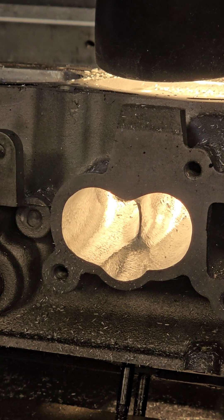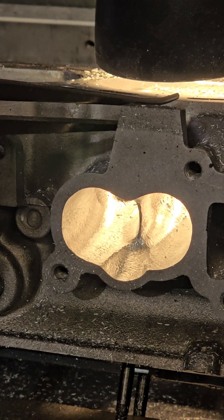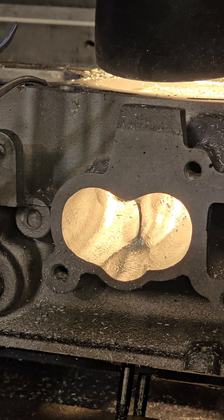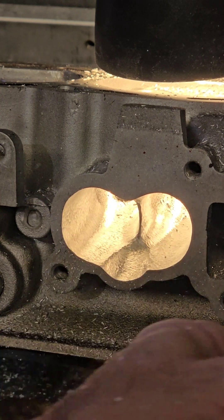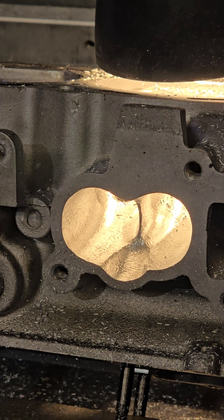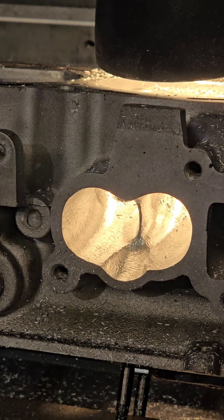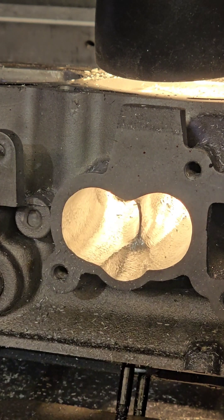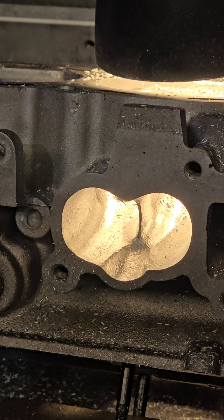Measure as you go and don't be afraid if they're not exactly the same. Look at the 2JZ — one port's coming in this way, one port's coming in that way, so you're never going to get them the same. But as long as you get the CSA profile and the air speed the same from port to port, the best way to get the air speed the same is the same diameter and same size, because everything else — the piston, the stroke, the RPM, cam timing — is already set. When you look at the core shift, some molds are up, some are down, some are left, some are right. Compensate as best you can but don't go hogging a wall all the way out just to make it look straight — you've gained nothing, in fact you've gone backwards. That's really a newbie mistake.